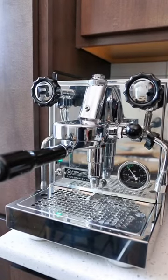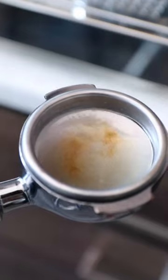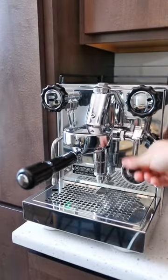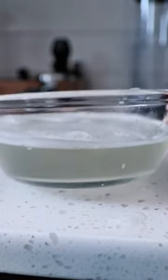You'll notice that the water that came out of the valve is foamy and silky — it's supposed to be that way. This is the Cafiza going up into the machine and breaking up any minerals, coffee grounds, or debris that's sitting in there. You'll want to keep doing that until the foamy water is entirely gone.